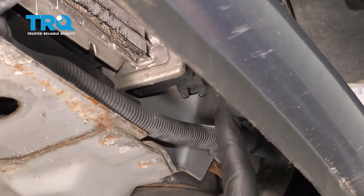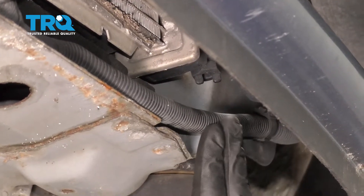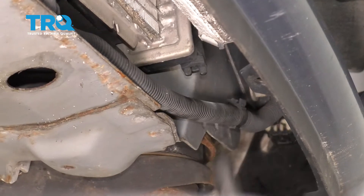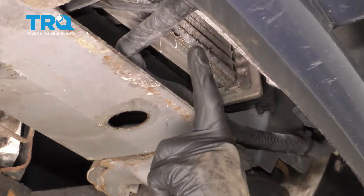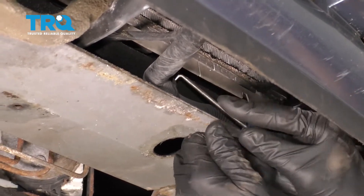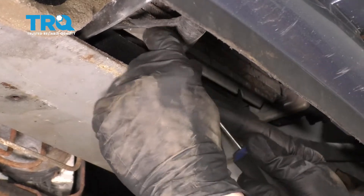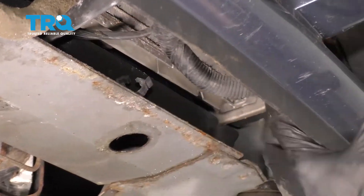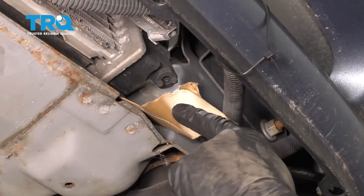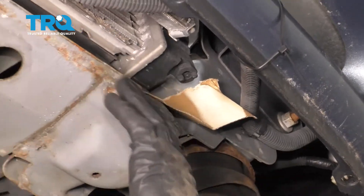When I remove this, coolant's going to come out of it. I want to make sure I don't have anything underneath that might divert the coolant and make a mess. We're going to divert this coolant directly into a receptacle so we can recycle it properly. You're going to find the mounting points for this wiring harness — there's one located right here. I'm just going to use a pick or a small screwdriver to carefully get in between this area and break it free. Once that's open, grab onto that wiring harness, give it a little tug, and pull it aside so it's free and clear. I used a small piece of cardboard to make a little funneling area to divert everything away so it doesn't make a mess.